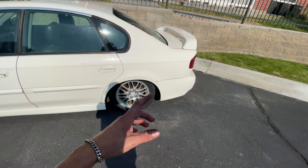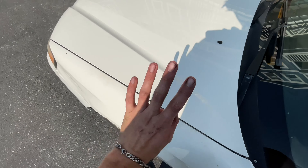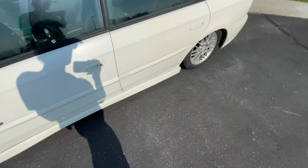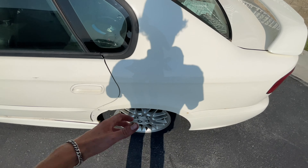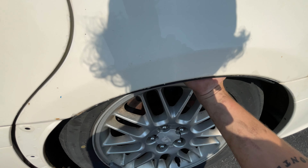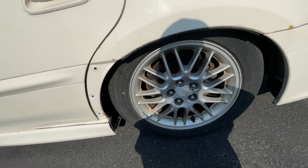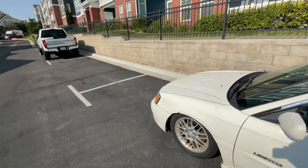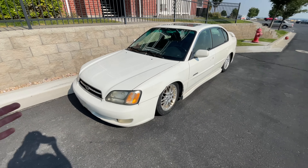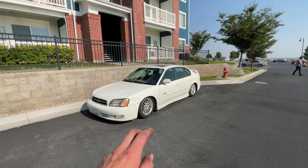The reason we didn't run all the camber in the front is because these wheels have such a high offset that with negative 9 degrees they were hitting the coil. So either throw new wheels on it or get spacers. The rear is literally maxed out — all the collars taken out, spun all the way down, spring sat free in the air. We still have about 3 inches of clearance until we rub, so I could throw a 25-mil spacer on, grab a 4-inch swift spring, go down another couple inches, and still be fine. I noticed my camber arms just got delivered, so that'll go on in the next video. Honestly impressed with how low these coilovers got it. Thank you for watching.